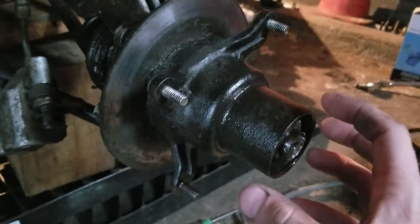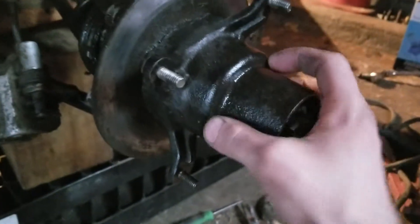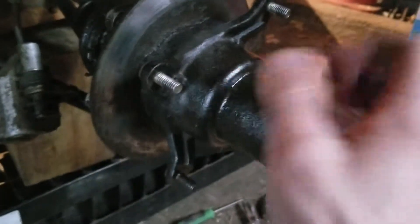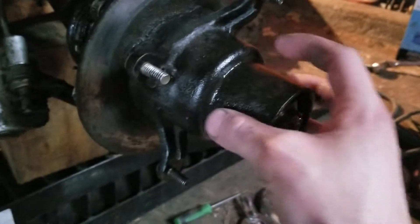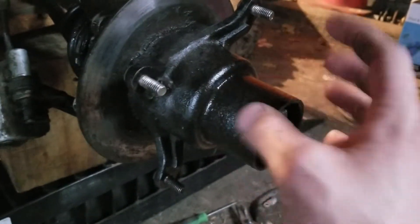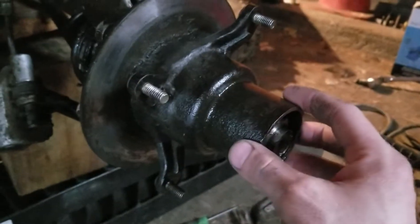What I did was I turned my ignition on and put on the armature plate, then just kept adjusting and tapping that outer race until the armature plate had a good grab on it.